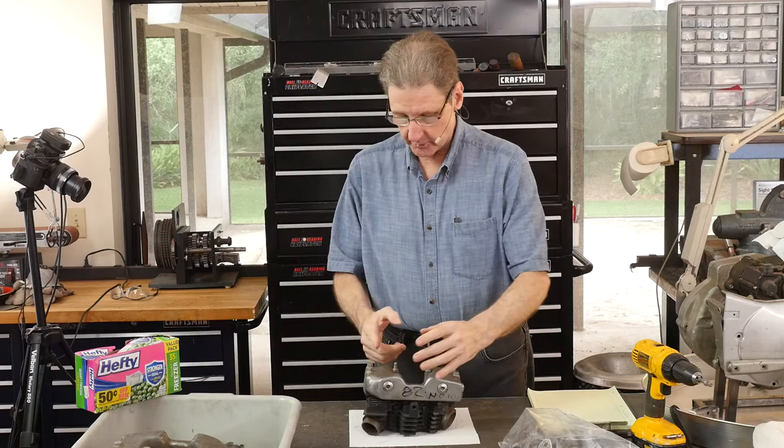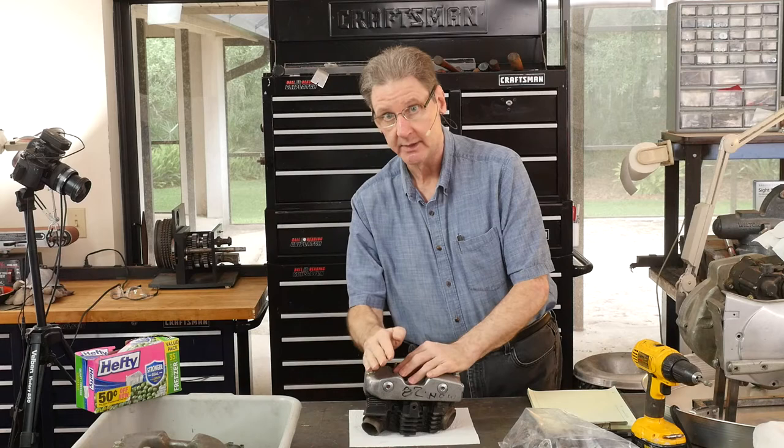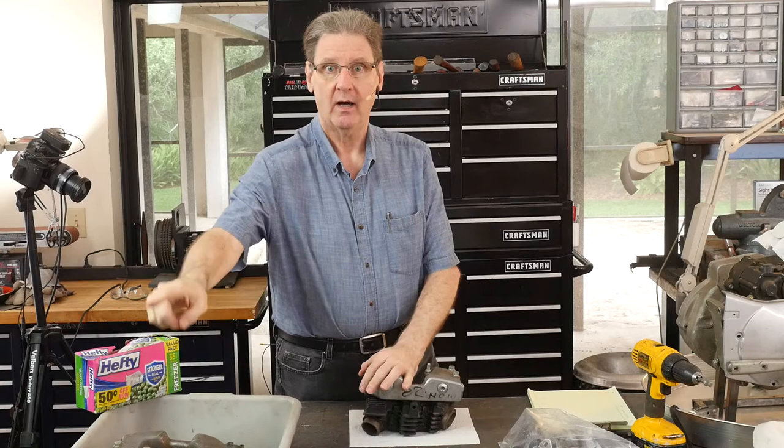Two quick tricks. There's an oil port on the exhaust rocker — exhaust rocker here — with a little hole drilled. You can accidentally swap that and get it on the intake of the other head. So don't do that, and make sure that little hole is clear and blown out. Every bike I've worked on has had some grunge in there obscuring that hole.